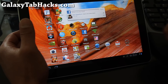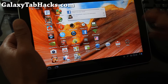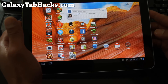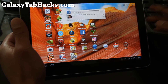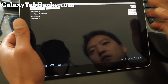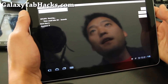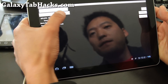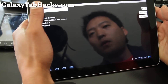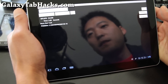There are two processors, so it's going to go from 2 GHz total to 2.8 GHz. It's going to be interesting. I'm going to run Ubuntu again and see if that improves performance too. But first, let me do a Linpack benchmark before I overclock. This is just stock — we'll run multi-thread and see what numbers we get. Results: 53.41, 54.638.